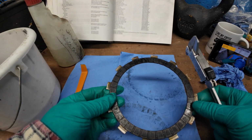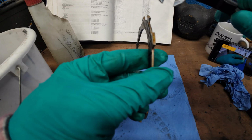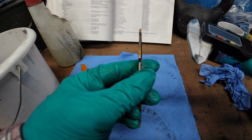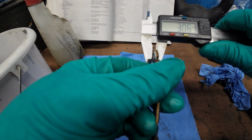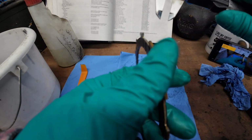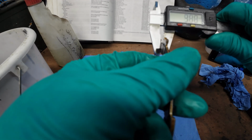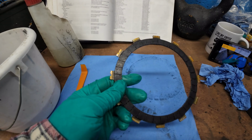So this now is the friction disc, the front one, and that goes that way round. So these are between 2.9 and 3.1, and it says the minimum wear should be 2.6. So that's 3.7. I'm checking it. A few pads around 3.6. Caliper's had a little dump at the moment. Let's have a look. 3.7. So that's averaging 3.6 to 3.7.